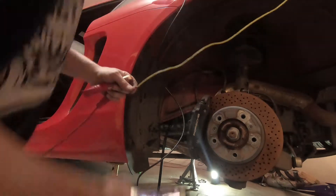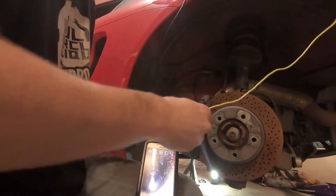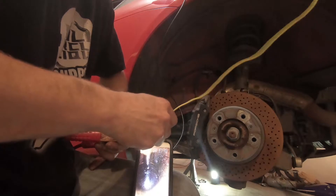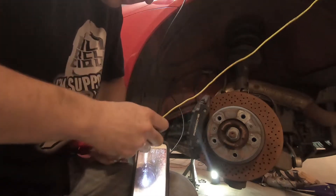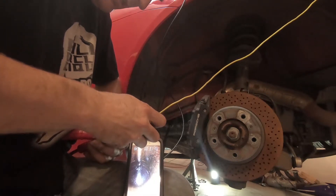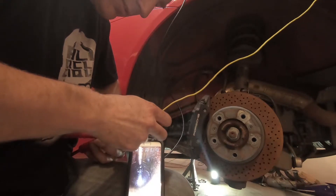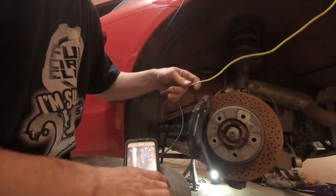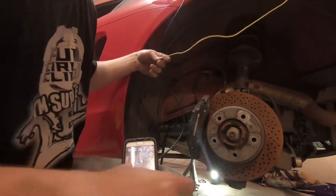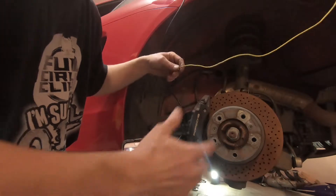Let me show you how this works. You can see that open and close - it just opened and closed. So now I know where that piston is on the four cycle - it's on the intake cycle. I'll bring it back around again until it opens. Just started to open there. So I know the piston is on its way down to suck the air and gas mixture in. Then when it gets to the bottom of the cylinder, the piston is going to come back up. And right before it gets to the very top is top dead center, and that's where I need to have it in order to do this leak down test.